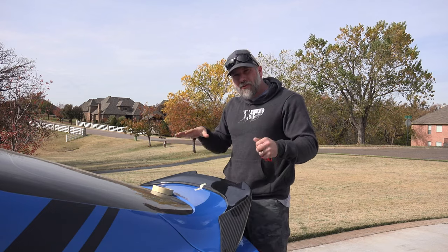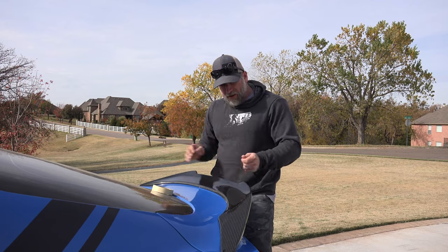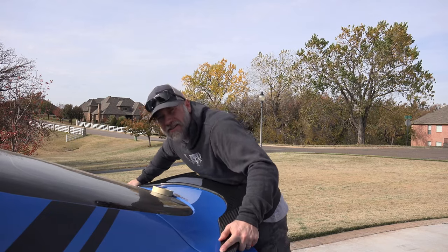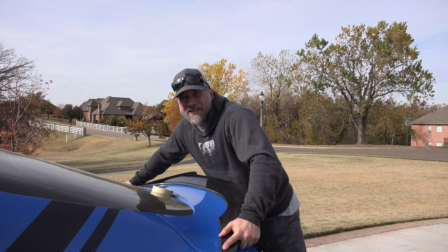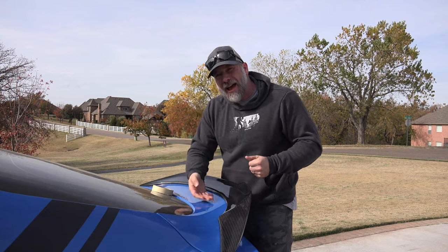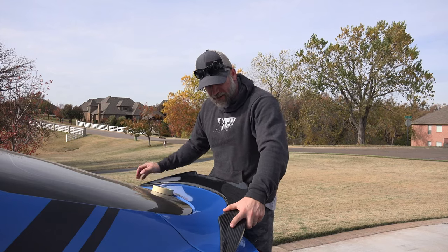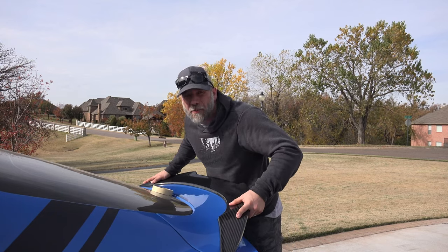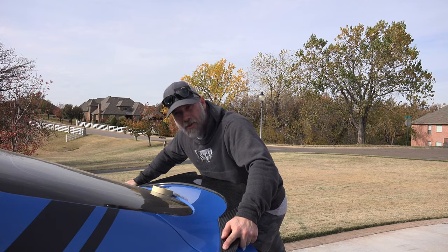Now we've got all of the 3M tape that's on the other side exposed. I'm going to peel this off while I'm here. And now I'm just going to put some weight on it and get this thing snug down on there. I'm going to let it sit out here in the heat. It's about a 62 degree day — you really should be 65 or above — but I've been letting this sit out here in the sun, so touching this it's probably 70 or 80 degrees easy. And then the heat from the sun is going to warm this up, which will help to keep that adhesive sticking.